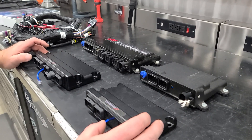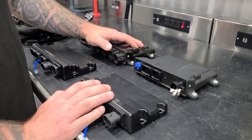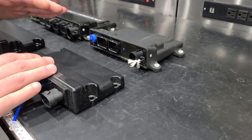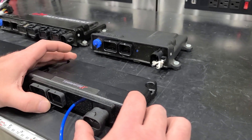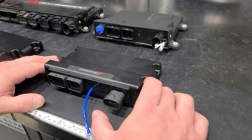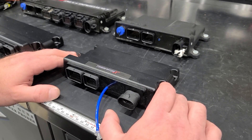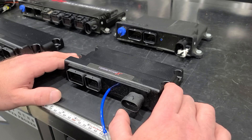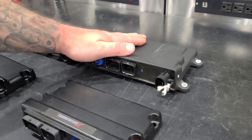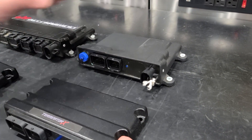The easiest way to describe this is Terminator X and Holley HP are very similar. The difference is Terminator X will only drive high impedance injectors — it won't drive low impedance injectors. Do not split the injector signal to two sets of injectors to try to get 16 injectors. It's got 8 injector outputs, and 4 inputs and outputs that are auxiliary.